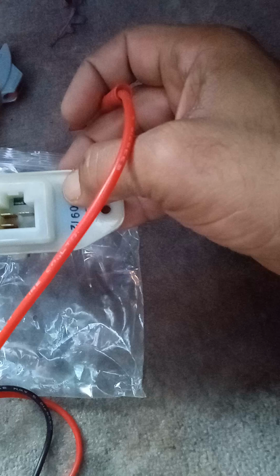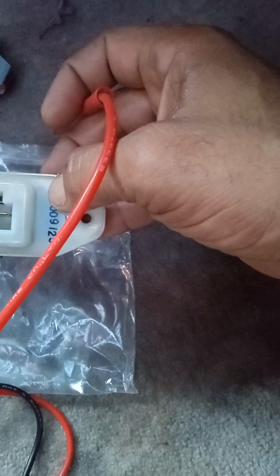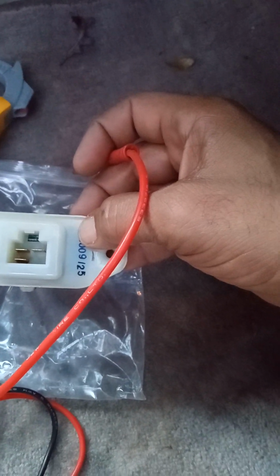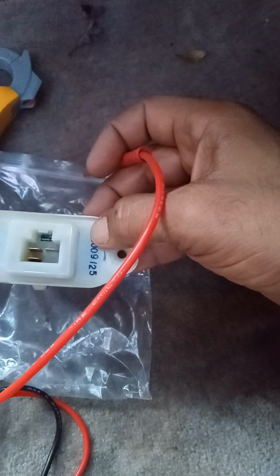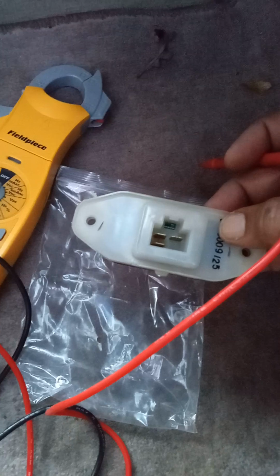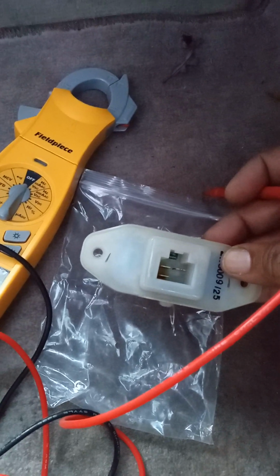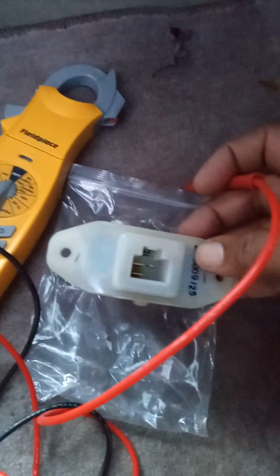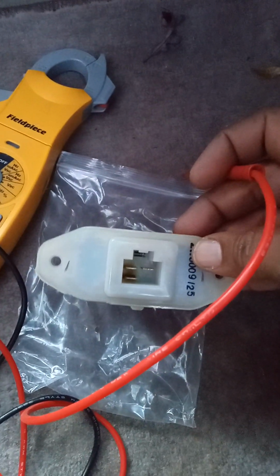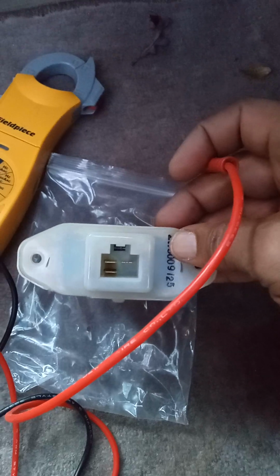But it is definitely, when you want to know, with your fan motor on your Nissan Maxima 2000 or your Infiniti I30 year 2000, if your blower motor stops working, most likely it's going to be because of the blower resistor or the blower fan motor itself. So probably I would just change both because it's really cheap to get them on Amazon. Don't go to the junkyard and try to get them because they're going to charge you about the same as a brand new one. I called them because I thought it would be a lot cheaper, but it's not.